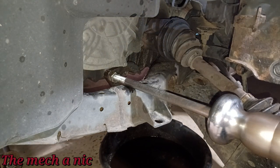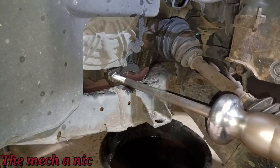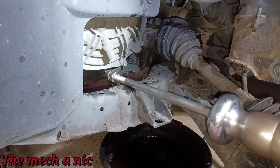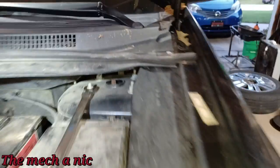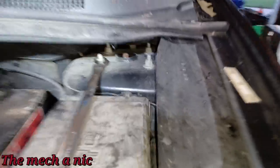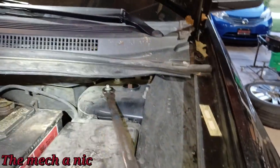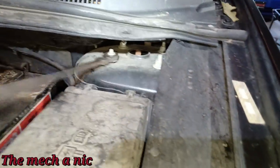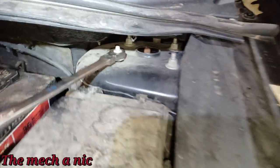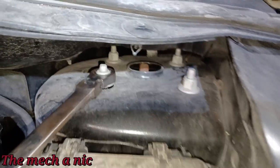The strut only has three bolts up top — well, it turns out there are actually four 13mm nuts. Let me think like a mechanic and do the smallest amount of work to get the job done. I'm going to remove the two front nuts completely and just loosen the two rear ones, and hopefully we can get the strut assembly out of the way just enough to clear the axle for a straight pull.